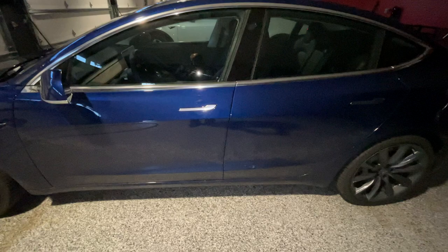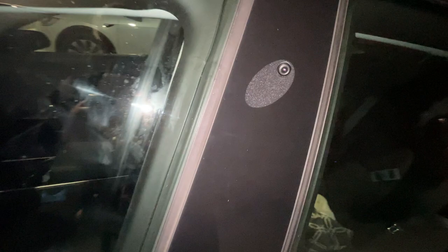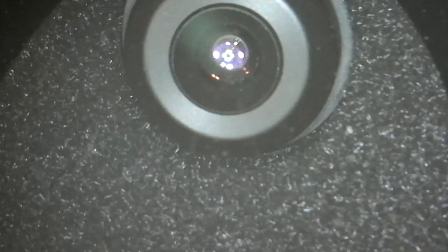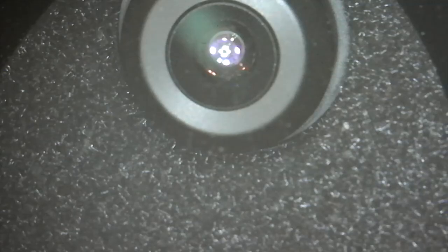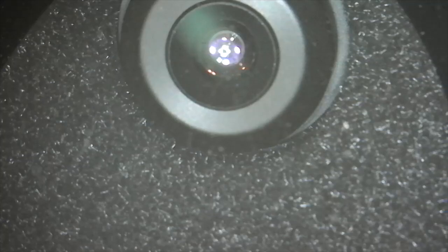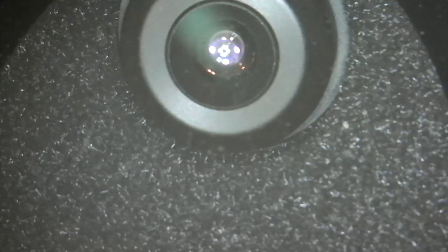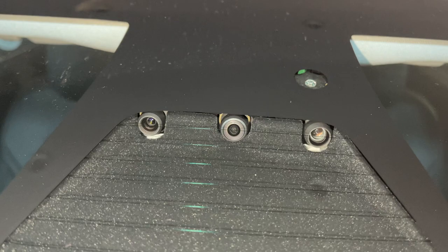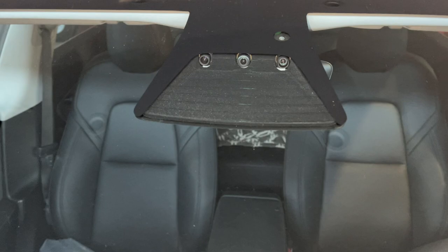So let's take a look at the side cameras on the car now. As you know the Tesla has eight cameras used for driving itself. I'm going to look at the B-post camera — this is located high, so let's have a look at that now. This is the left B-post camera. It looks to the front and to the left of the car. As you can see it's pretty clean — essentially no contamination here at all. These cameras look really well; they don't seem to get as contaminated as the rest. But if you go through some nasty mud and it does splash up on the side of the car, these cameras will also get affected. I've also got three cameras located in the middle of the top of the front window — these are glass on the outside and when you run the windshield wipers they actually clean those, so we're not going to look at those today.